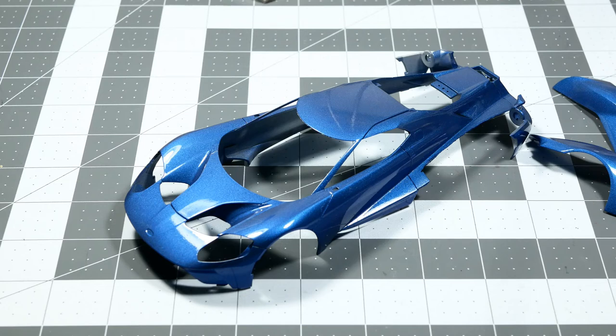The Toyota Risen body is still in the purple pond — I'm just letting that one soak. It took a lot of effort between the purple pond, Super Clean stripping, and elbow grease just to get it back so I could start over again with fresh primer. Here we are now — I clear coated this last night, so it's not even in the 24-hour window yet. I need to wait until probably Thursday or Friday before I can start working on it. There are some small debris spots here and there that I need to wet sand out — nothing major, nothing like the first round. I think some of it might even be air bubbles.